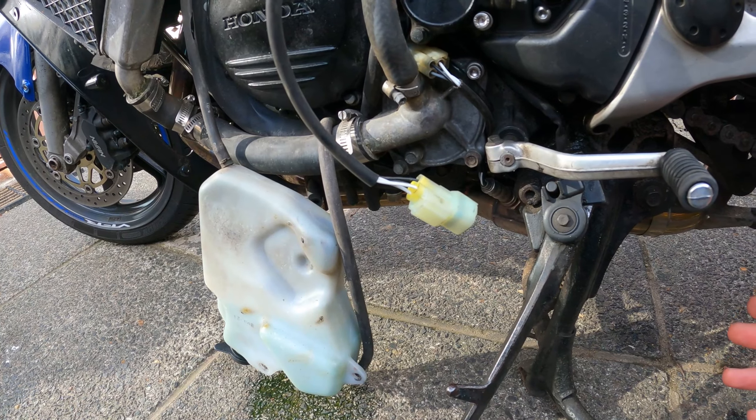Basically I'm going to disconnect them, and to get around error lights showing up, we're just going to shove a couple of resistors in here. I'll show you what the bike does while it's started up and you can see the light flashing. Obviously that's not ideal because it's annoying - we know it's not an issue, but it's annoying.